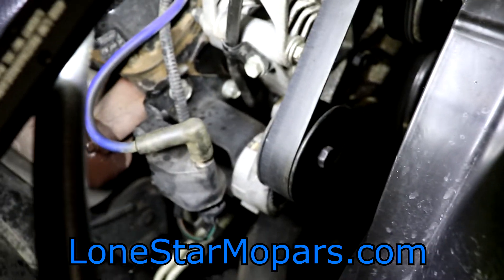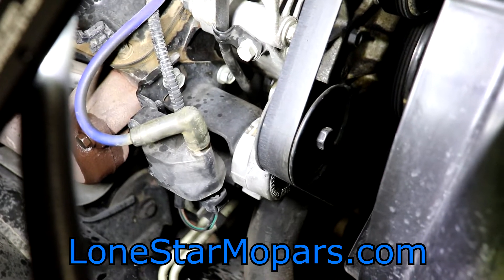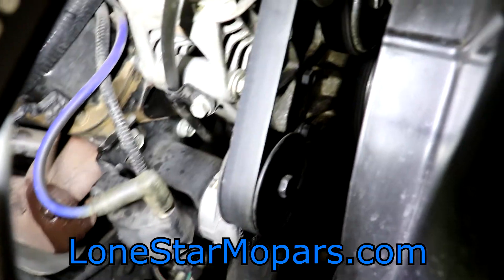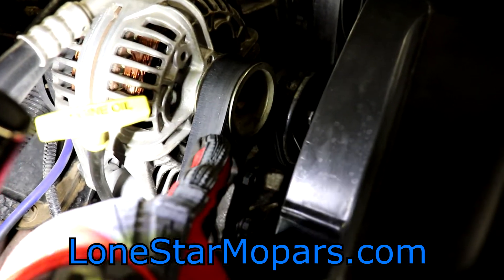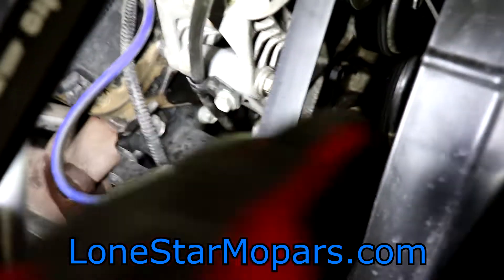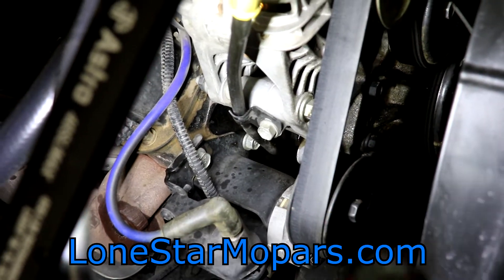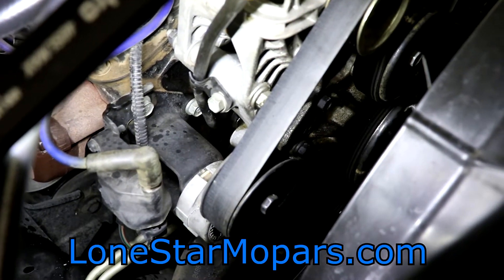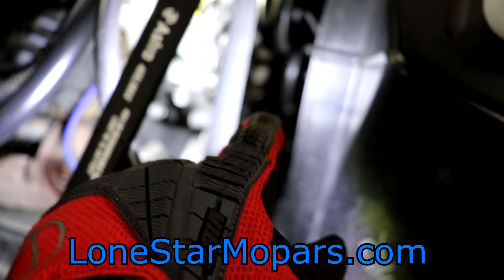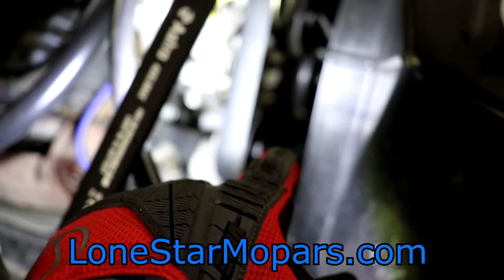I want to highlight where I had the wrench positioned. Here is our alternator, there's the pulley off the alternator, there is the idler pulley — that's 15-millimeter, that's what you'll ratchet to remove the serpentine belt. I had the wrench positioned about there, which is really the only good spot. Hit it with the engineer's hammer with the padded face to protect the wrench and broke it free. Now I'm going to remove that fan, fish the bolt out, tackle the four 10-millimeters, then take you to the bench to show you the proper bolt size.